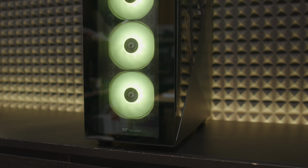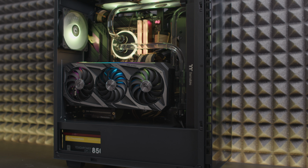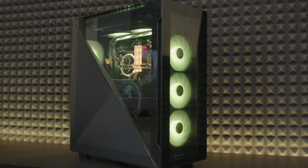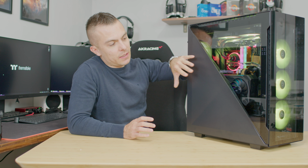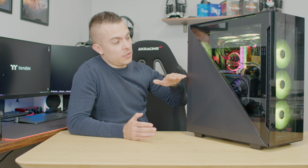Definitely something interesting from Thermaltake. I would like to see some more cases with a front mesh part and RGB fans, which you could control through your motherboard or anything similar to that, and maybe work around with this. This is a cool sheen, but it could be done even better, without a doubt. Maybe even give a bit of length to the case, just so that a standard pump, maybe a D5 or DDC, can fit even with the GPU going horizontally. Yeah, that would be really cool.